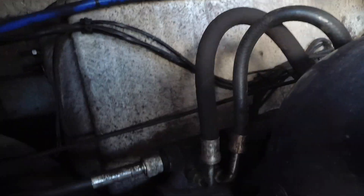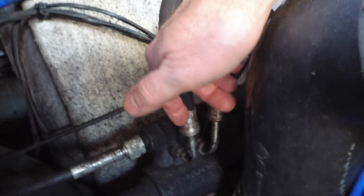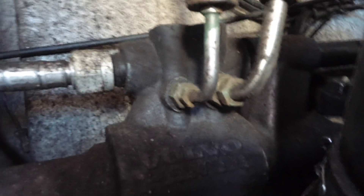Here's another look at the steering components - here's where the hydraulic lines come into the steering rack, and there's where the cable comes into the steering rack. I tried to take a good look at this and I don't see any leaking here either. So far I haven't found anything major, which is great - it could just be low on fluid and putting some fluid in could fix this problem right up.